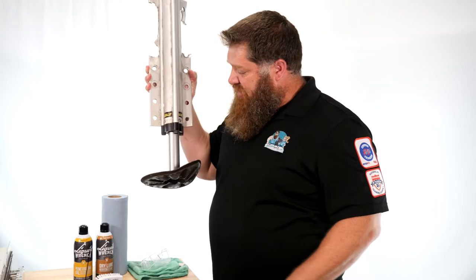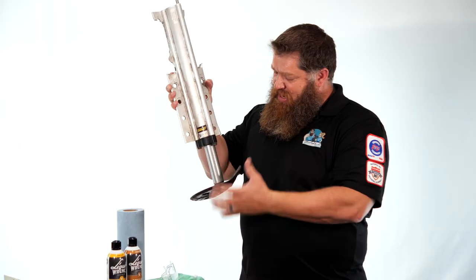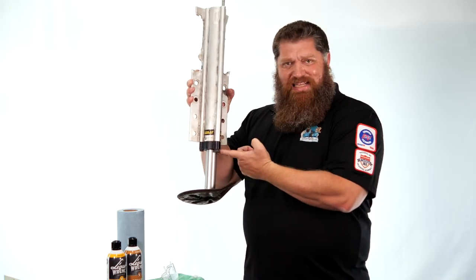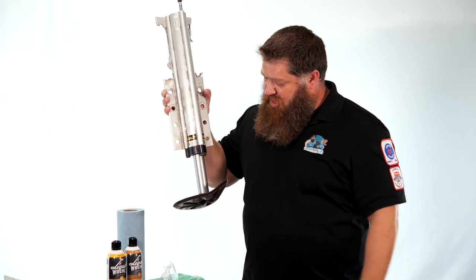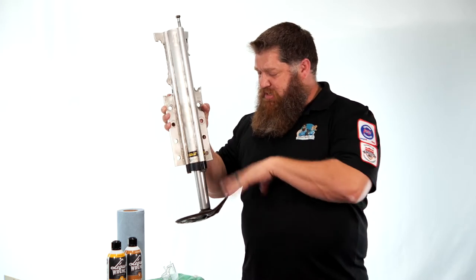This week, let's talk about cleaning your landing gear and your slide-outs. So here we have our landing gear. Did you know that we actually need to clean these cylinders? What happens is we get dirt and debris lined up in here, and as it comes up, it begins to break the seal and we have hydraulic fluid leaking all over the place. And of course, we have to call a service tech to repair that.